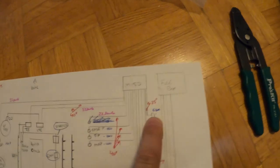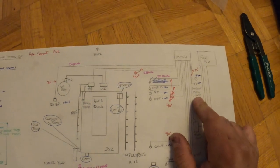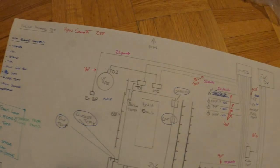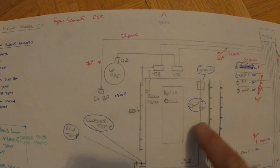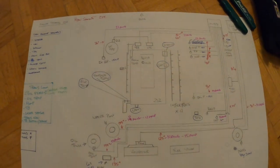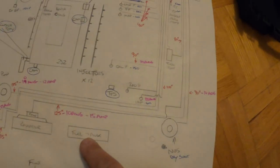Starting here: I got ambient pressure and temperature sensors sitting in the engine bay to measure ambient conditions. Then there's crankcase pressure, fuel pressure, MAP sensor, LTC which is the MoTeC O2 controller, and TC8 which is the EGTs and exhaust back pressure. Then the starter, cam — the ones circled in blue are the ones on the stock harness, so I kept those there. That's the basic cam, TPS, and front fuse box so when you turn the key the car starts. We're also adding a small primer pump because the fuel tank in the front sits lower than the pump.